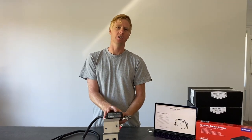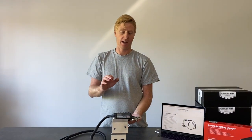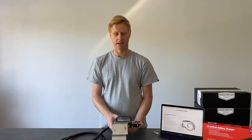This is a three-in-one unit. It's basically a three-stage charger while you're driving along, a solar controller when you're stopped with green power priority, and it's also an isolator — isolating the two batteries so that you can't flatten the main start battery.